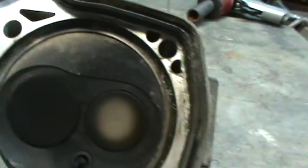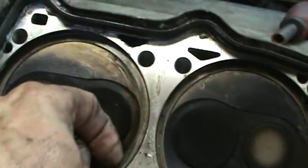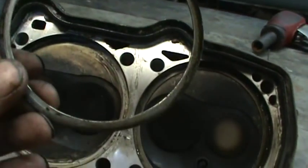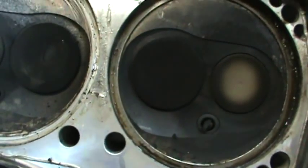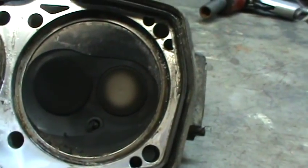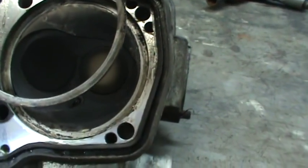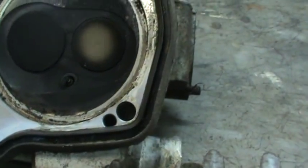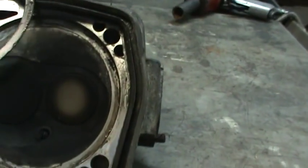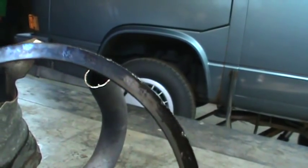These are actually head gaskets — if any of these come out you don't want to mar them with anything. It looks okay on that side. The head looks good too, the surface. These are all replaced — I don't think there are that many miles on them — but they fail because the coolant causes corrosion, pits the head, and then it'll start leaking around it. That looks okay, but I have a feeling it's right right there — that's where I think our failure is.